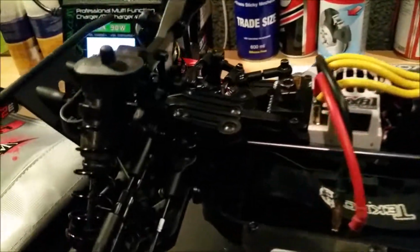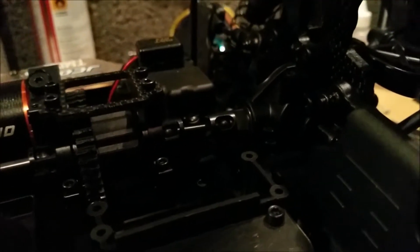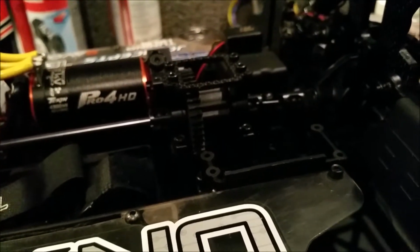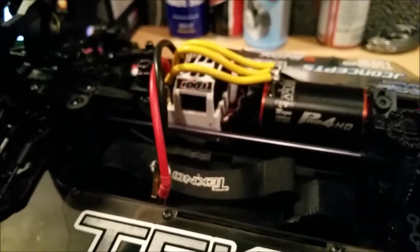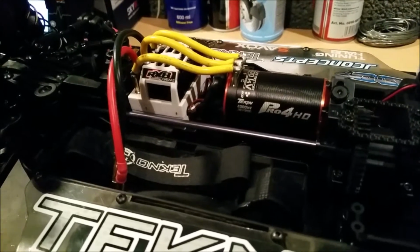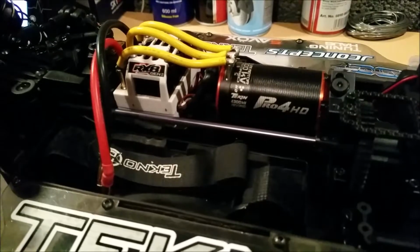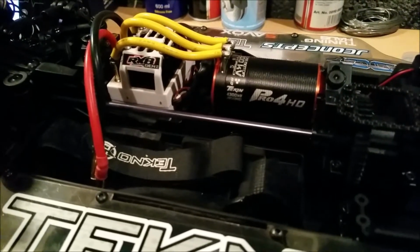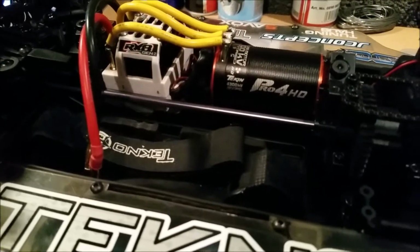New things on this truck that weren't on the old one. It's a bit dark in there, but you have lightened diff outdrives right through on all 3 diffs, so that's front, centre, rear. There's an angled gearbox in the rear to reduce the angle of this rear dog bone. On the previous truck there was a much steeper angle, so the pins on the ends of the dog bone drive shaft would wear quite significantly fairly quickly, so this little design change is functional. They haven't gone for metal cross pins in the diffs this time to try and reduce the rotational mass. I've also gone one step further and replaced the stock tapered aluminium drive shaft for the optional drive shaft from the previous SCT410. Reason for that is I had one in the box, and the original kit one got a bit damaged with some stones that stuck in the front, so I took that out and replaced it with this one. Before I did that, I weighed it. Interesting to find that this was actually 2 grams lighter, so that also helps with reducing the rotational mass.